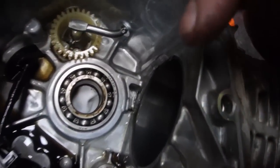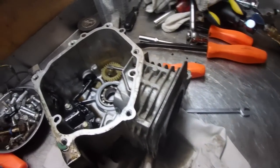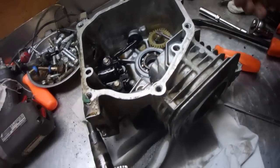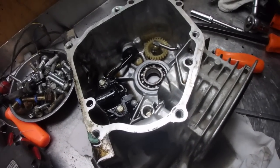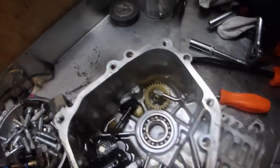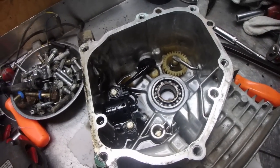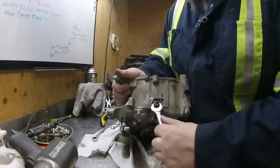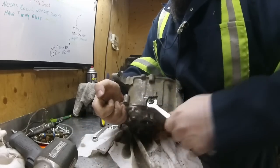The cylinder is actually just a sleeve, so I'm probably going to save this block — it may come in handy in the future. I haven't been able to find a sleeve for it, but I haven't looked that hard. Basically the only things left to do to this engine are to pull the oil sending unit out and the electrical connection on the outside. This is the governor. Once you pull this nut off, you'll be able to pull that oil sending unit out.